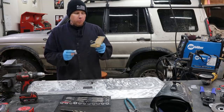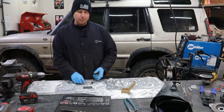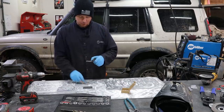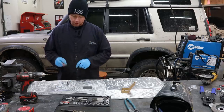These Amazon hinges came with a bunch of tiny hardware, so I'm not going to be able to use a nut on the backside — which is no big deal. We're going to use a tap. I found the right size thread, I'm 99% sure I did. So I'm going to drill into these little spacers we made, tap the holes, and then we can just run our hardware right into this plate.